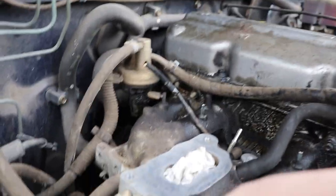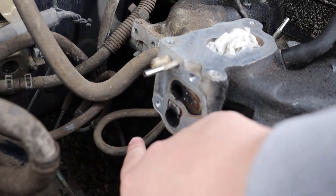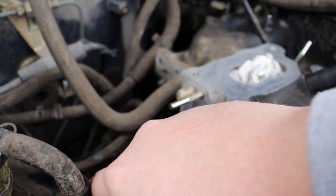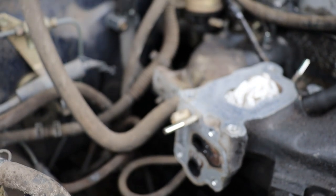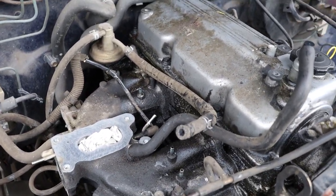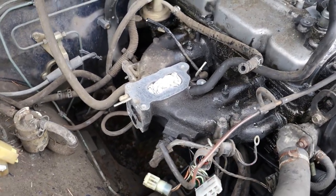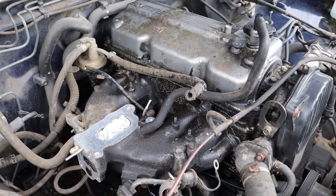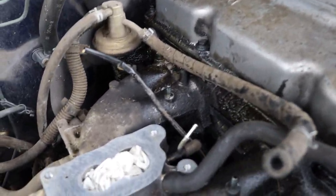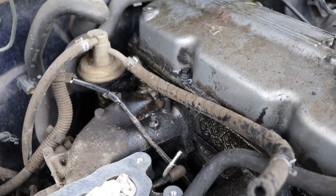And there's also two lines down here, but I just circled this line over here back because with the Weber carb kit, I think it comes with five and I need six. So if you're doing this yourself, pick up some vacuum plugs. It'll make your life a lot easier, especially if you don't already have some of them plugged off like me.